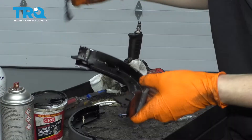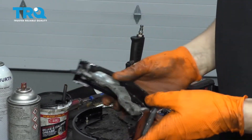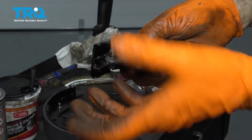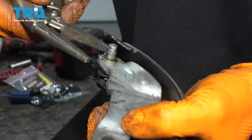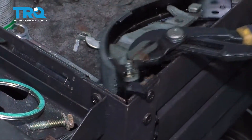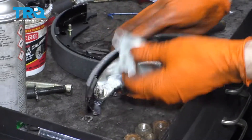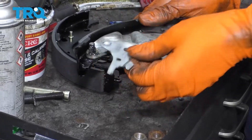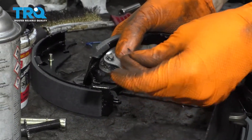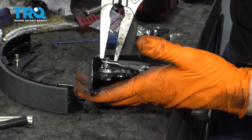Before I put on the parking brake arm, I'm just going to grease this pin a little bit to ensure that the arm can pivot freely for a long time. Slide that on — now we have to lock it in. I have a brand new clip here; I'm going to slide it on, and as you can see it doesn't lock until you crush it together. So with some pliers I'm going to squeeze the end of it. That's perfect. Now take your other lever, add just a tiny bit of grease — you don't want a whole lot here because you don't want it to get on the braking material. Add your other lever, take this little C-clip locking ring, press it right on and that will lock in both of them.